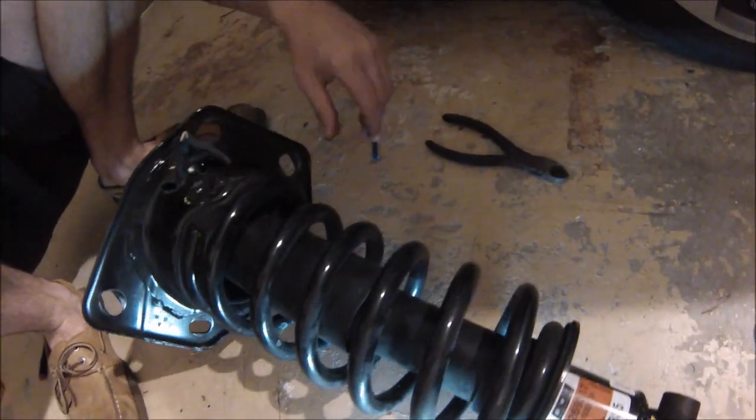I've been working on this connector trying to get a de-pin. I went and actually bought a de-pinning tool but it's not long enough — it's the only one that AutoZone had. So I'm taking the high road and not wasting any more time — I'm just going to cut them and splice them back together. If you can find a de-pinning tool and you have the patience, go for it. I don't have the patience or the right tool. I'm going to cut it, put them back together, pull this spring off the same as the other one, take the hat off, put the new spring on, and we'll be good to go.